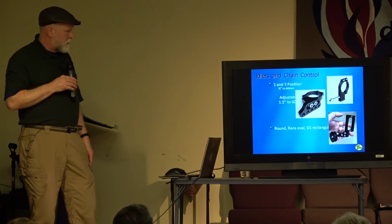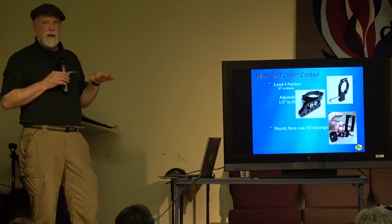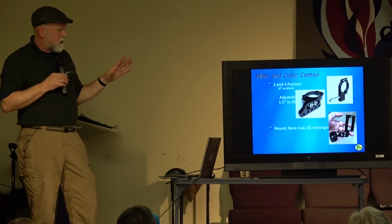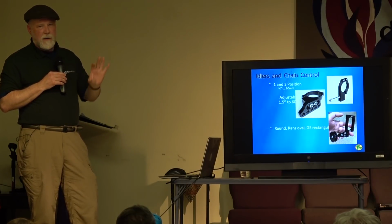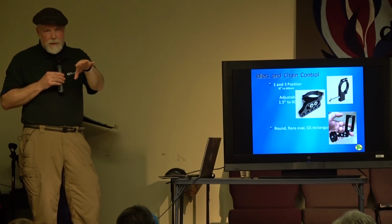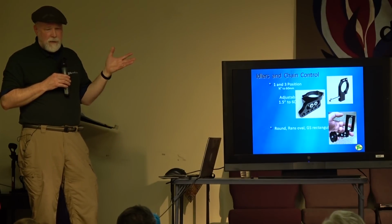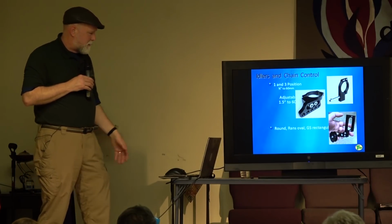Idlers and chain control. It's not so much of an issue with current recumbent bikes and trikes, but it used to be that a lot of chain lines on recumbents could use some upgrades. The stock ones weren't quite what you might want. So that's kind of how we got into things originally a long time ago, making separate clamp-on idler mounts and a lot of different idlers where you could move where the idler was. So you could fine-tune where the chain went if you needed to, you know, shoot through between a couple tubes or just under the bottom of the seat or whatever. And we still make all those things and still sell them every day. But the need for that is a lot less than it used to be. But if you have an older bike or trike and you're restoring it and you want to improve the chain line or reduce the amount of chain tube or something like that, we make all kinds of clamps for idlers.